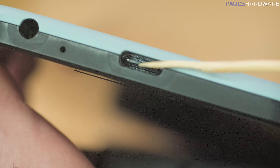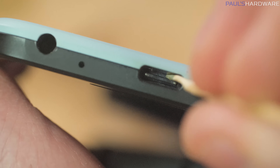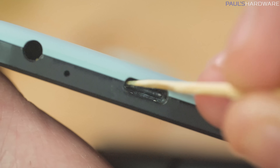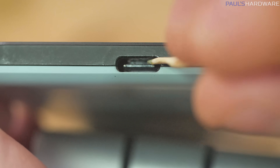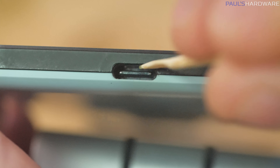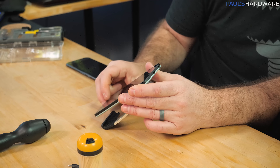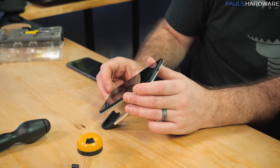So that's why I was recommending those little square-shaped toothpicks — they're a little bit smaller and might be able to get down in this groove a little bit more easily. The general technique is to start on one end, get down to the bottom of the channel, and just sort of push along the edge and see anything that's gunked up or built up right there. Push it along until you get down to the other end, then lift it up and out and get it out of your Type-C port. Flip the phone over if that helps give you a little better access to the other side. Just repeat this, and once you get a layer of gunk up, go back down because there might be more stuff caked down there. I had to do this three or four times with my phone before it actually got completely cleaned out.